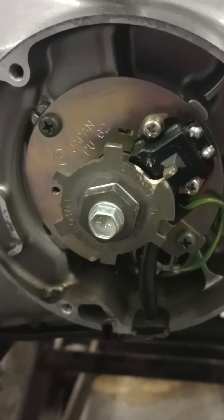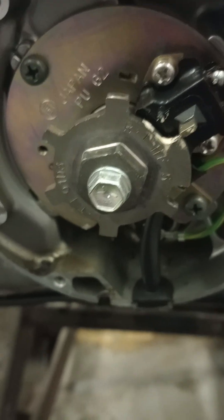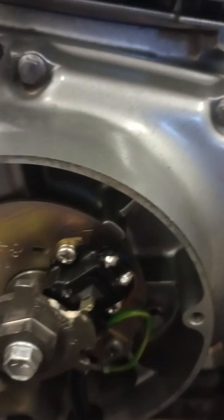For your timing mark up here, you're looking for your number one with an arrow that points to the right front of the cylinder, number two arrow up there, and over here is your number three with an arrow. You want 18 pins in between number two and number three. That is the proper way to identify and time this motor, starting with right cylinder RT first, then you time LT and double check the timing on that side. Hope this helps everybody — a little more clarity.